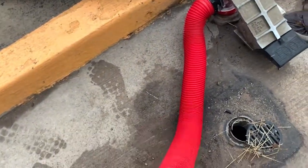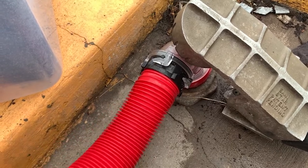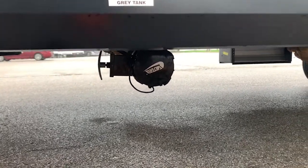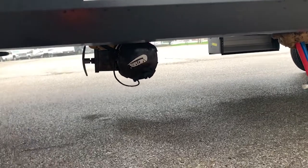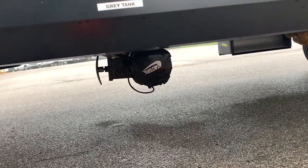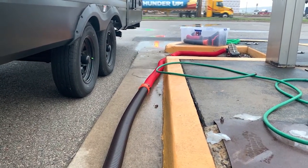There's a lot of water trapped in this hose — make sure you do this before you disconnect. All right, we've got it all out. Make sure the tank is closed and the lever is pushed in. When you get ready to take off that cap, make sure it's pushed in — sometimes going down the road the vibration causes it to open. If that happens and you take that cap off, it's going to swoosh waste right at you. And that concludes the tutorial on dumping the tanks — the dirty part of camping.